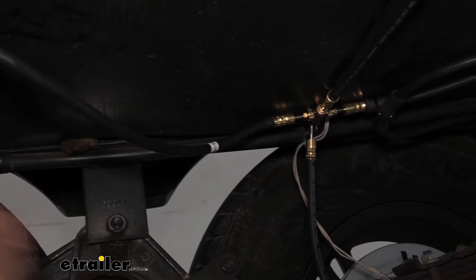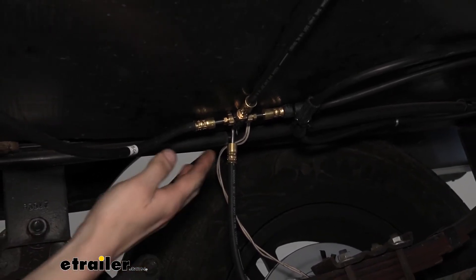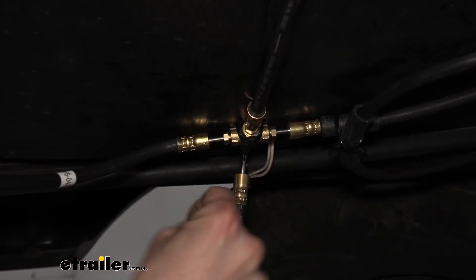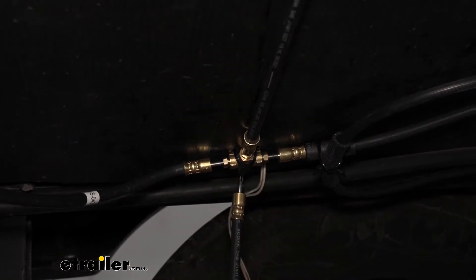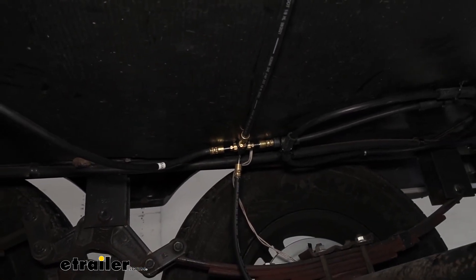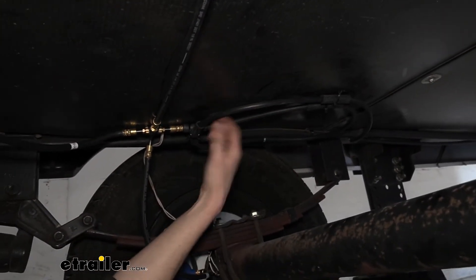I'm pretty impressed because having done quite a few of these, every time I do a hard line kit I end up going back and finding a couple of spots that leak. I'm tightening them so tight, and since these are all softer metal, even with line wrenches I feel like I'm almost getting to the point of stripping them. I get real peace of mind with flexible lines knowing that when I put them together I'll probably have no problems getting them to seal, and you can usually route them much more cleanly. If there's excess, it's easy to coil it up like we did here.